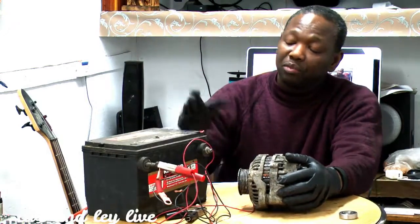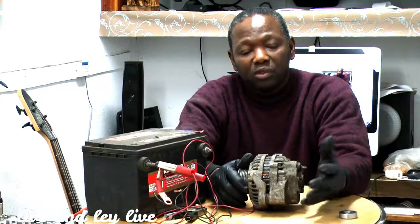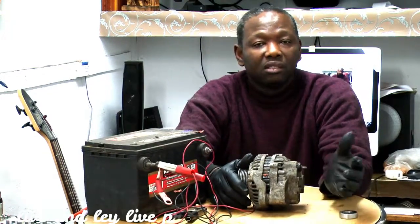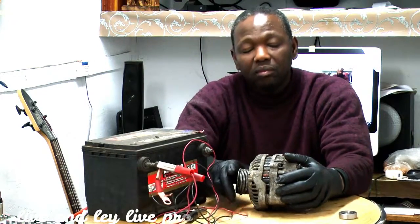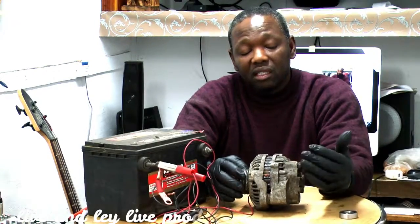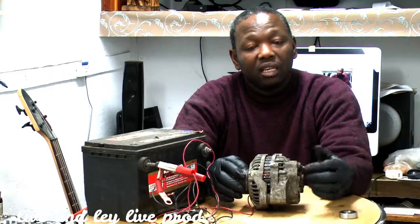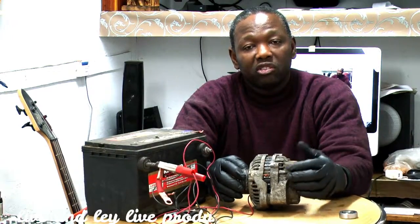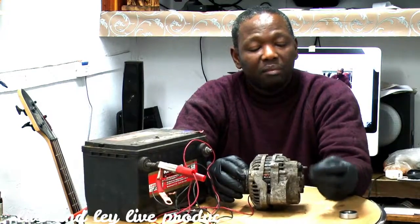What happens if you put your meter still there and you see your voltage drop from 14 to 12, it's fluctuating between 12, 11, 13. So what you're going to do now — first thing you're going to check is the belt. Because most cars have a tensioner, the belt tensioner. You're going to check the tensioner to make sure you have enough pressure on your belt, so your belt is not loose and flabby, not shaking.